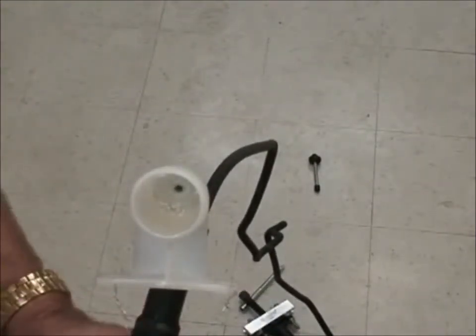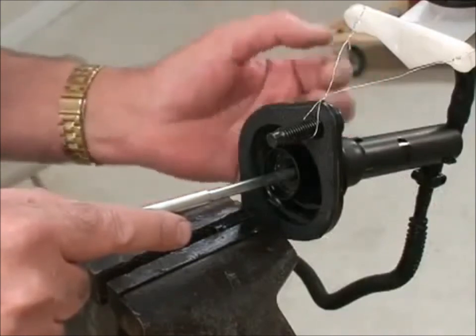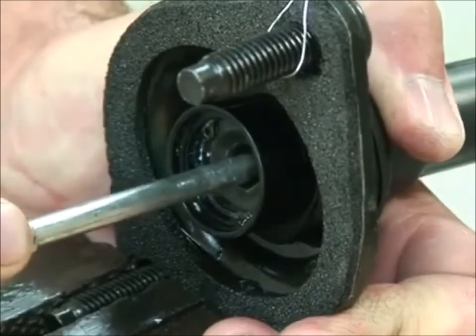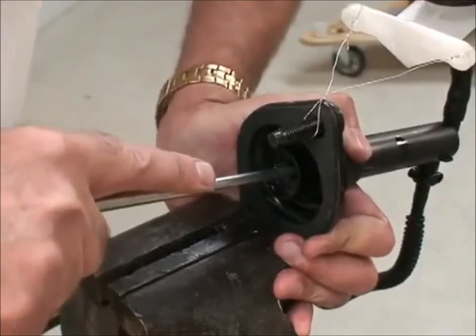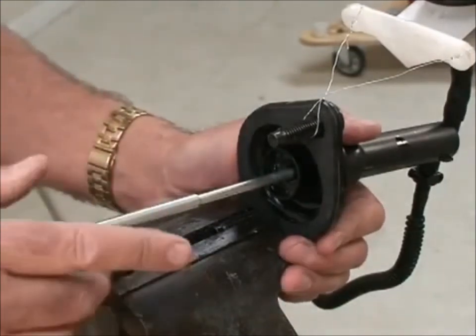Let's check our work — we're done. I'm going to show you the master cylinder pushrod. I've got the slave cylinder blocked, bled it, reverse bled it, pushed the piston back up. I want to push on the pushrod and watch how far it and the piston assembly move before it becomes hard. We are less than an eighth of an inch — this system is bled. It's ready to install on the truck or car or whatever you're working on.